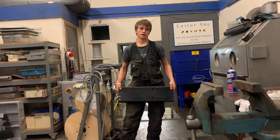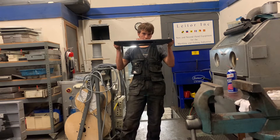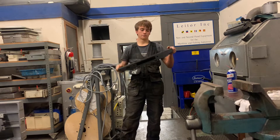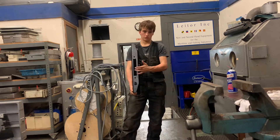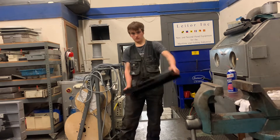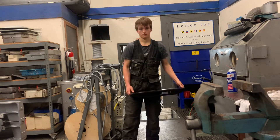It gives me a half inch more space between the C-channel for the winch to actually sit down in so I can mount it properly. This orientation is upside down for a lot of people, but for our installation this is the right way so I can actually have the cable going to the fairlead without a mess. Let's get to installing this — I hope this is the last time I film this.